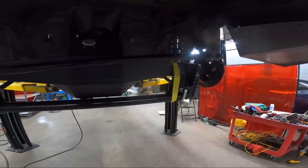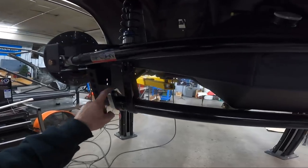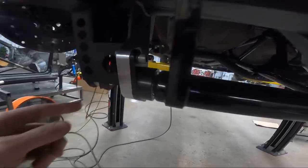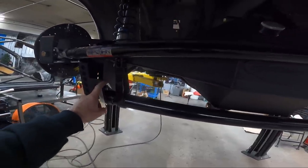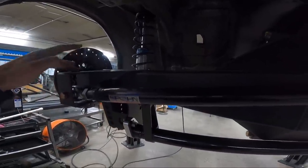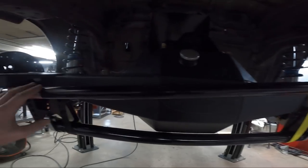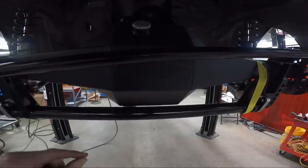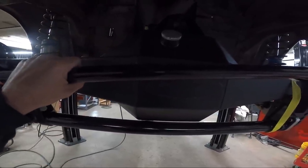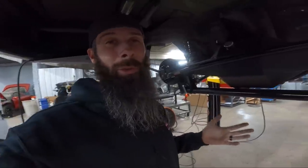A lot of you remember from the previous videos — some wires got crossed whenever this rear end was ordered, and the anti-roll bar wouldn't fit. We had offset billet brackets machined so that would still work out. Then for some reason the panhard bar bracket still got put on this rear, which we're obviously doing away with. This is pretty convenient though, because it helps us locate the rear side-to-side in the middle where it needs to be while we mock up, and it allowed Jonathan to put the rear in the car previously and keep it up at the shop.